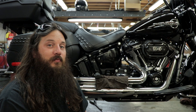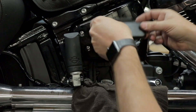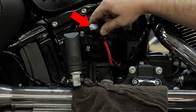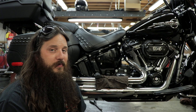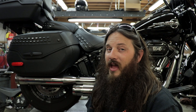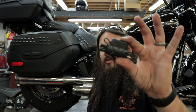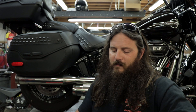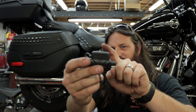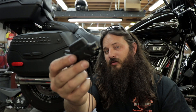These batteries are a pain — that's all there is to it. I did find a place for the lead that requires no tools to access and isn't dangling out: just remove the dipstick, pop the cover off, and I can pull the lead out easily. I added a little tape because the weather cap doesn't stay on well. The wires coming off this harness are 8-gauge — significantly larger than a regular battery tender lead — and that matters because you're sending a lot of power to the battery and need the right wire size. The extra adapter included has a fuse and lets you plug a regular battery tender lead into the other end.